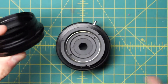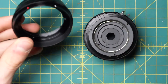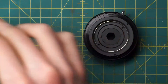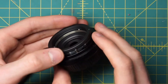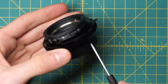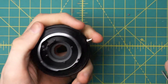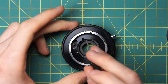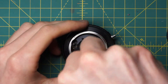So I have this — just a metal ring. This is what would normally be the focusing ring in a lens, but in this one, since there is no focusing mechanism, it's just a regular metal ring. Now we've exposed the diaphragm assembly itself, which is this gray section in here, and then the base of the lens — the aperture control ring and the mounting plate. Looking at the back of the lens and at that mounting plate, the mounting plate itself is just held in place by four little black screws going around inside of the mount. So undo these four and then we can lift off the mounting plate.